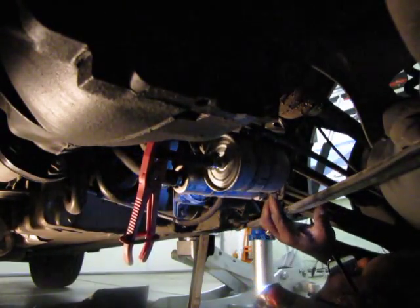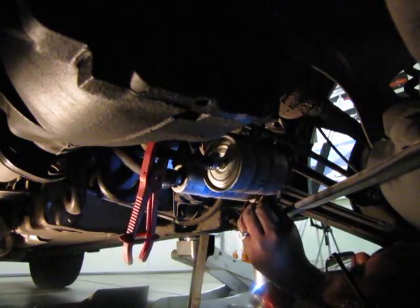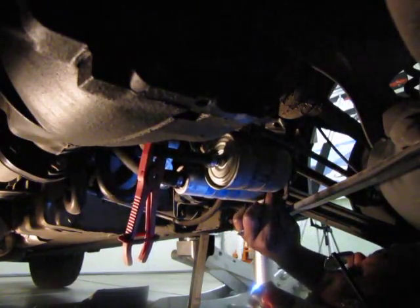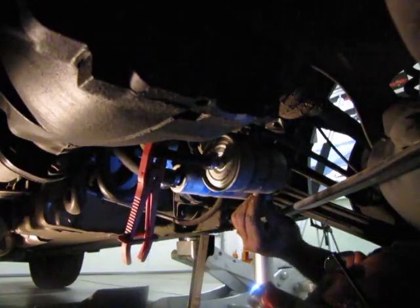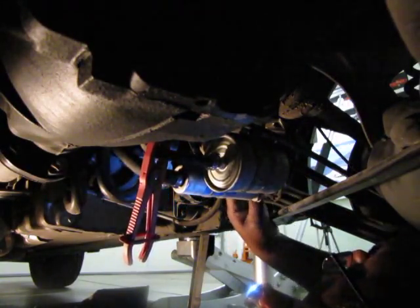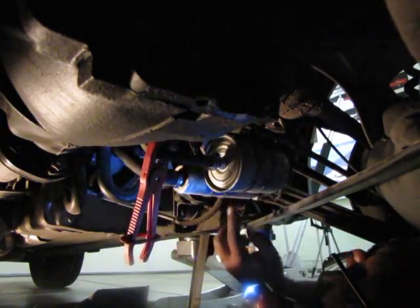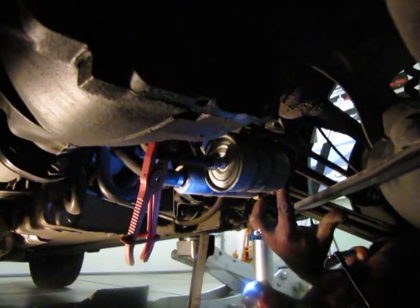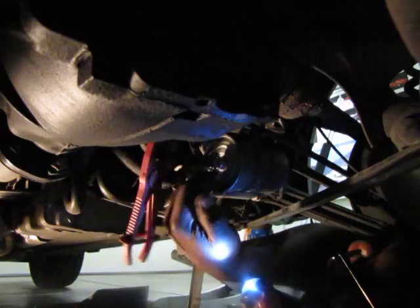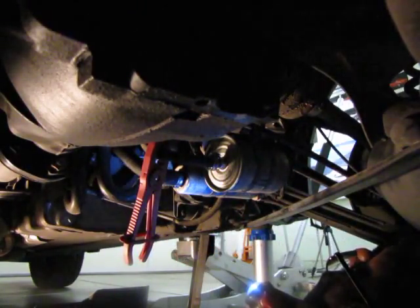So I'm just exposing these first. This is in pretty good shape, so I might not have to replace these little covers. And I'll come down here and mark this wire. Then I'll unscrew these little screws, take the leader loose, take these hose clamps off, both ends of the pump, both ends of the fuel filter, noting the direction of the fuel filter. It's the little fat end that's the intake, and then the out. And just hook them back up, and there you go.